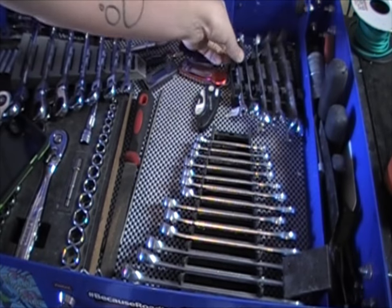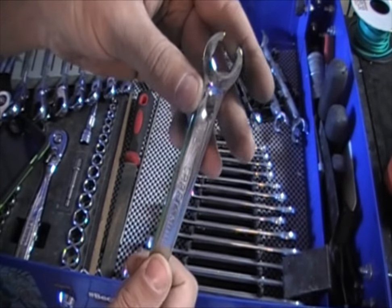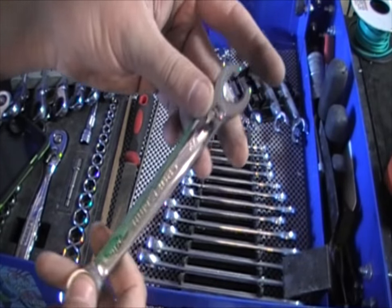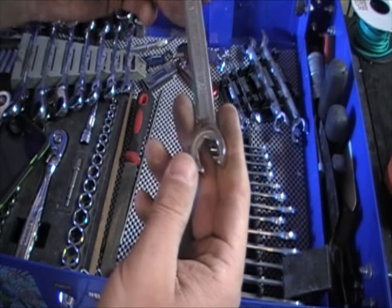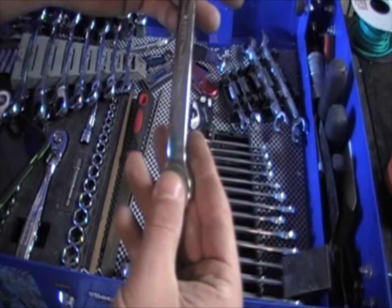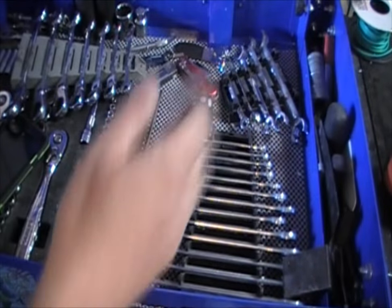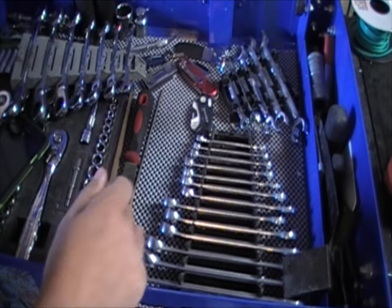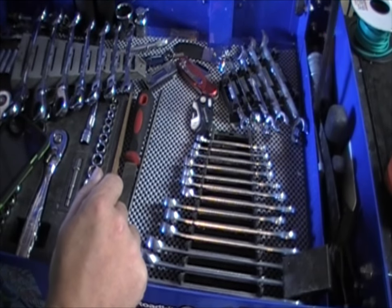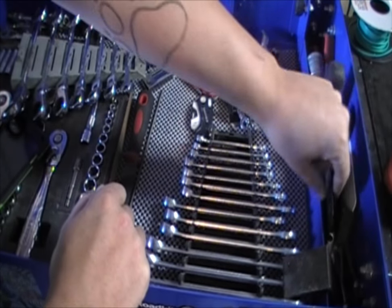And then these are for hoses or line fittings, and these are really nice to get around and get those line nuts off, like for brake lines or fuel lines or something of that nature. And so those are really helpful to use. And then at Harbor Freight, I picked up a set of crowbars. There's a bunch of them that come with it. So those are kind of nice to have. You always end up having to pry something if you're going to work on cars, unfortunately.